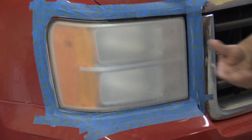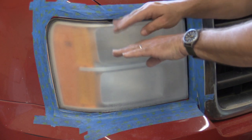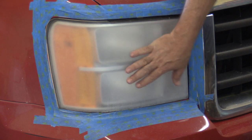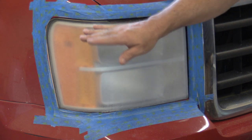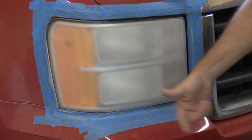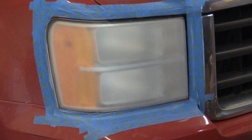We'll go ahead and switch over to 1500. All we're doing is keep lowering the mountains, if you will — make it as smooth as we can a little at a time. What we're doing with the sandpaper is getting rid of the scratch from the grit before, slowly working our way up. There's little grooves and cuts, and now I'm going to flatten those grooves and cuts with the next, less aggressive sandpaper as I work my way up the stack.